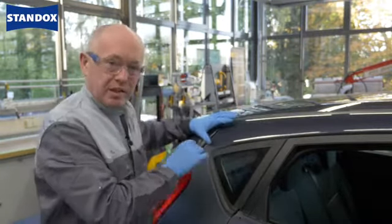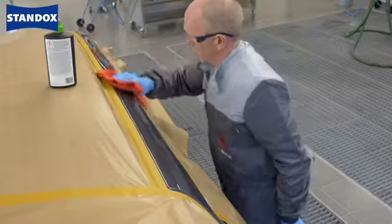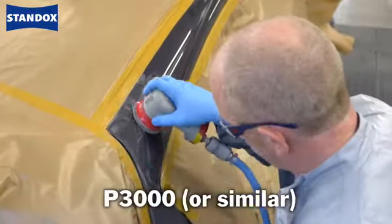The process related to this clear though is slightly different. What I want to do is clean it, polish it, clean it again to remove the residue, lightly sand it before a final clean and placing the car in the spray booth.